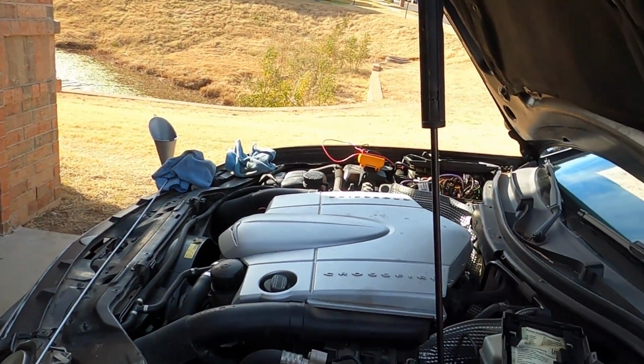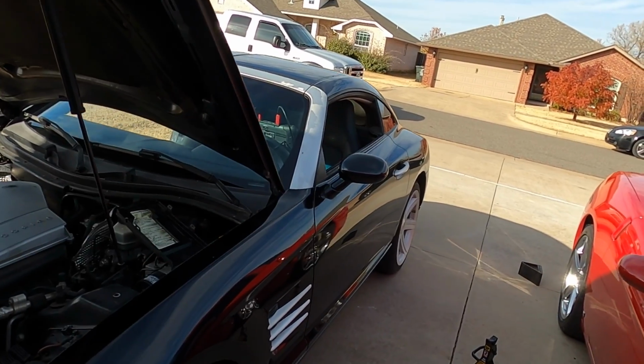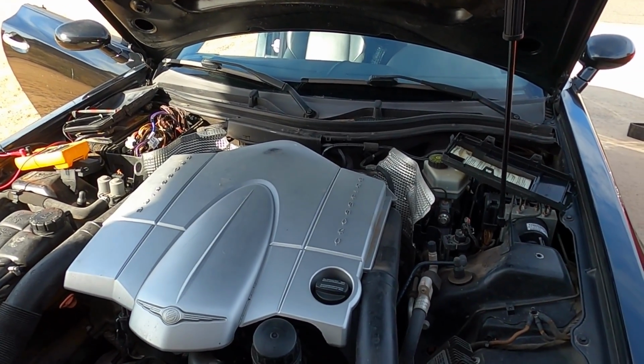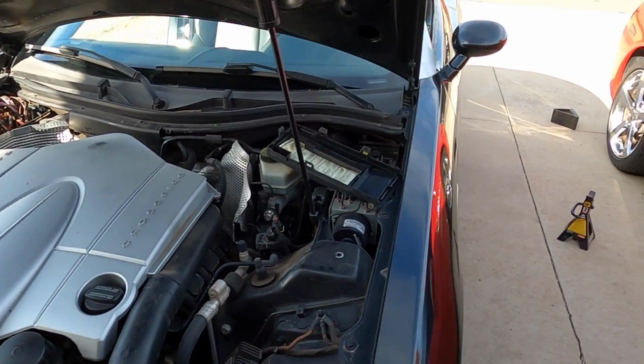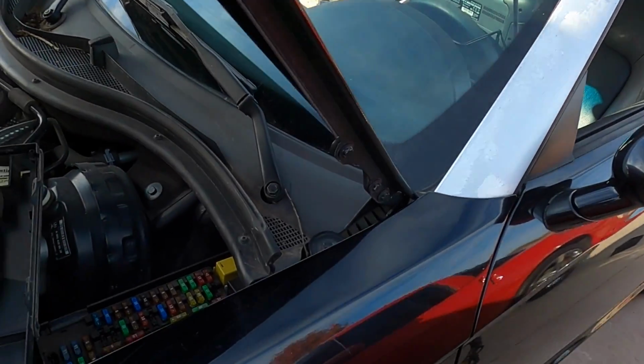It can't tell when the radio is on or off, and the radio is on. When you put it in auto scan mode, it checks amplifiers, radios, everything, and it doesn't know that the radio is on. And also the radio doesn't have any sound. The radio comes on, but there's no sound, so I figure we have a problem with an amplifier.